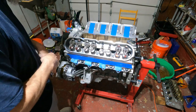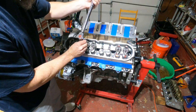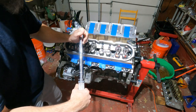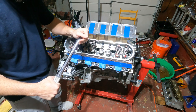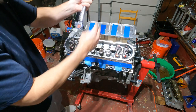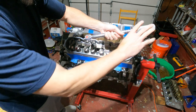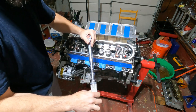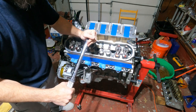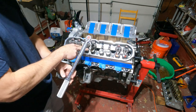So now we'll do our same method on both of these. These should check out. 12 o'clock position right there. We're gonna start turning. We're getting about 12 o'clock position, just snagging up a little bit, and perfect. So we're right in our range that we want. And we'll go over to this one, make sure it wasn't a fluke. So we're in the 12 o'clock position, start around, hitting some resistance around the 6 o'clock position, and perfect. So these two are good to go.